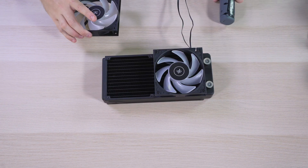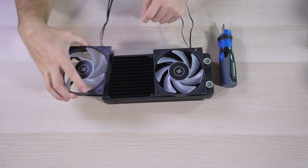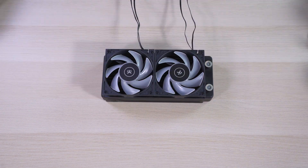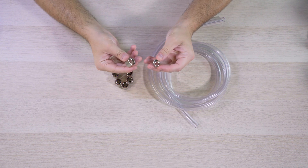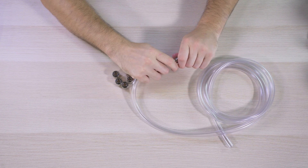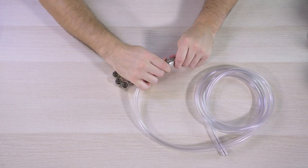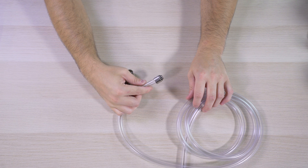I'm putting the fans on the open hole side of the radiator, which is gonna push the air through the rad. Then just send the long screws down into the holes and tighten up — be careful not to over tighten, and that goes with any computer part. Let's grab our tubes and fittings and separate the compression fittings into two pieces. Send the tube through the outer fitting, then push the tube onto the barb fitting, bring the fitting pieces together and tighten. This was mainly just a demonstration — you're gonna want to wait until everything's in its final place before actually putting the barb on.